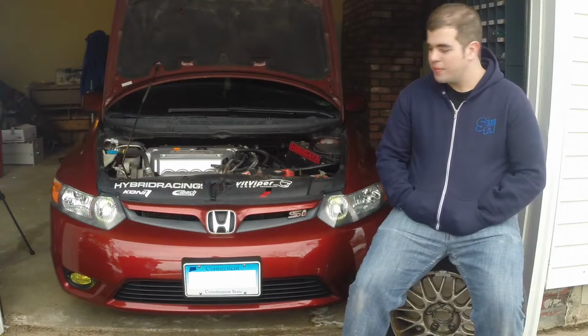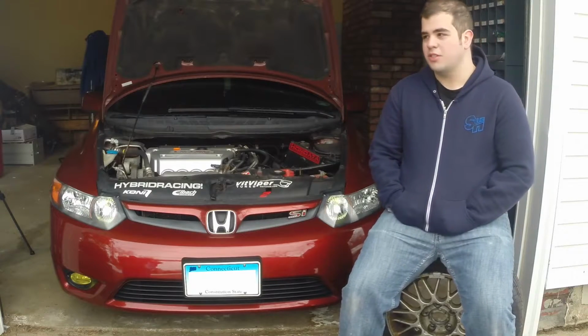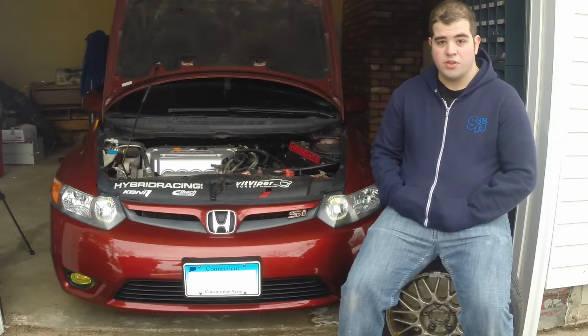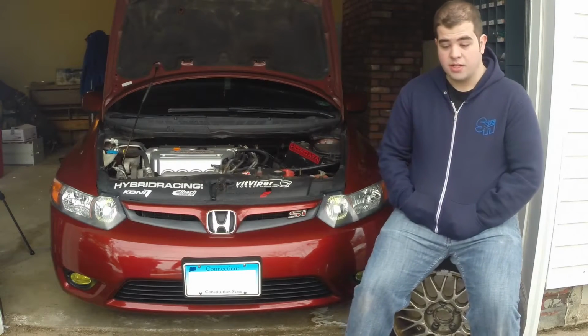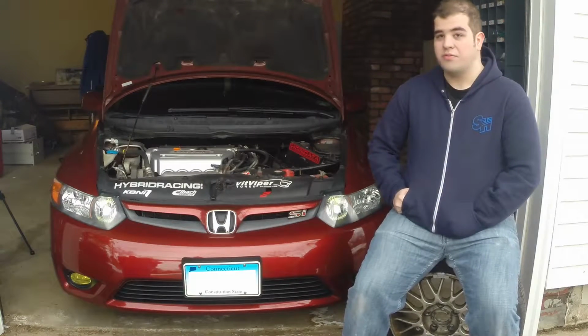The reason why I went with my suspension setup is I didn't have the budget for coilovers, and I didn't feel like going with anything like Raceland or even BC or, damn it, what's the other BC, the basic coilovers like Godspeed, BC, D2 coilovers, all of those. I mean, they're good for daily driving, but in terms of performance, they don't give you the correct dampening and all that stuff. So I decided to go with the best struts, and I went with Eibach Pro Kit springs because they drop the car just enough that I can still daily drive the car. I mean, I live up in New England, so it's rough trying to daily drive a slammed car. So Eibach Pro Kit springs, they're a great spring.